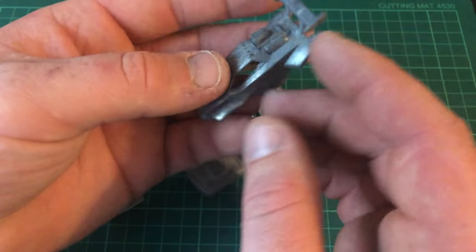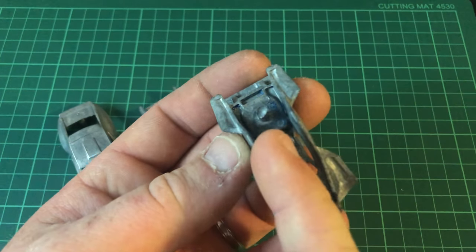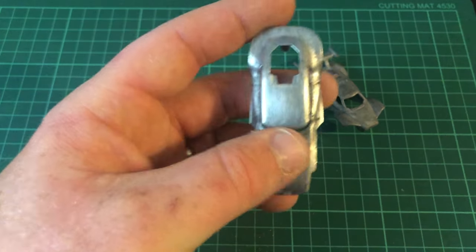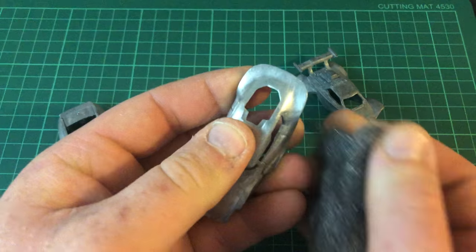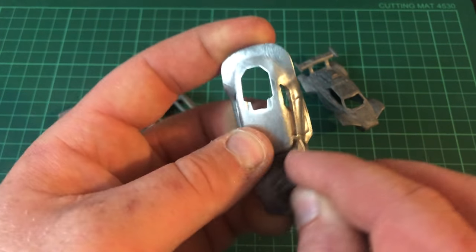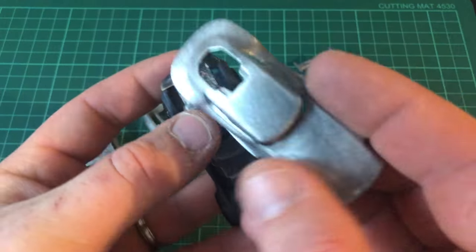The final step, once you're happy with the amount of paint stripped off - on this buggy there's very little left, only a couple of bits. One step I always do before priming, because it's had paint stripper on it, is to get some fine wire wool and go over the top. It gives it a bit of a shine and puts a key into it just for the primer to stick, and also removes any residue from the paint stripper.